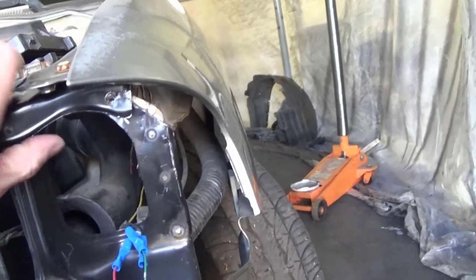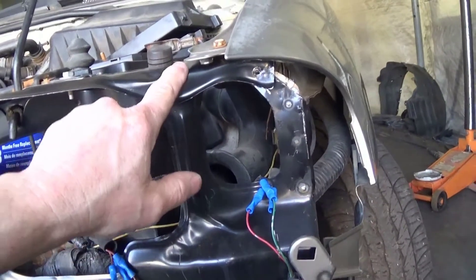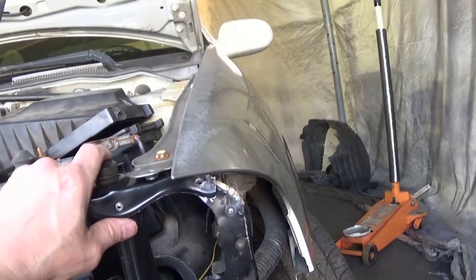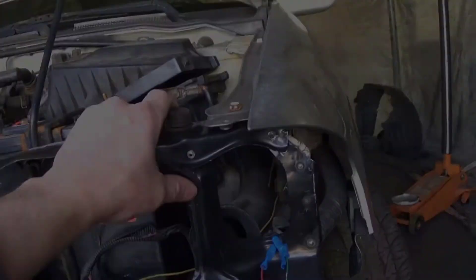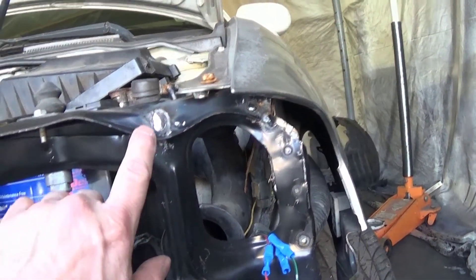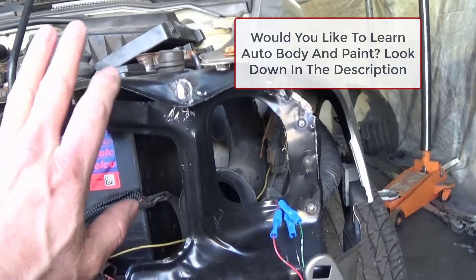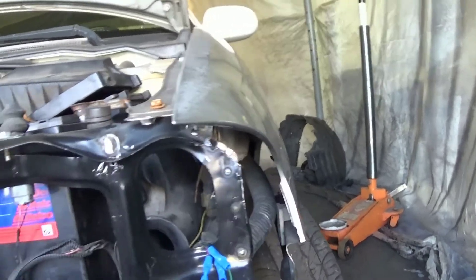I've drilled out those two welds and as you can see it's flexible now. I just have to bend this up — take that bolt loose, probably the other fender bolt too, take the middle one loose, then bring this up and get it adjusted. I'll clamp it when the fender fits right, and when that gap is right I'll spot weld it back in. I've spot welded it up now — you can see where the original weld was and how far I had to raise it to get the fender straightened up. Aftermarket radiator supports are pretty good but every once in a while, especially with frame damage, you get a combination of aftermarket not being exactly on the money and the frame being bent.